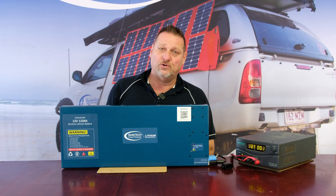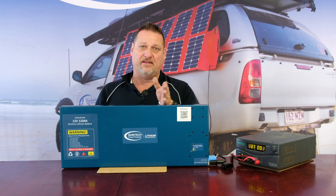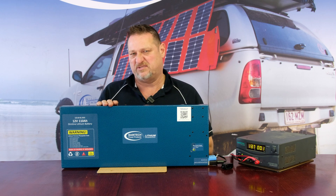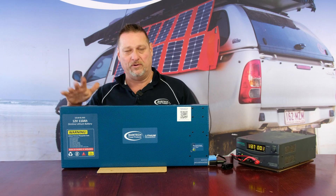There is one way that you can do it. A normal battery charger that just has charging modes only is not recommended, because it'll cut in float voltage at 13.2 volts, which means your lithium battery is only going to be around 80% charged — because it needs to float at about 13.8 volts or higher.